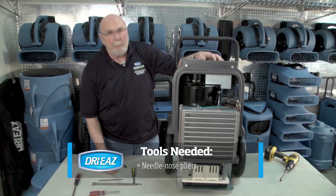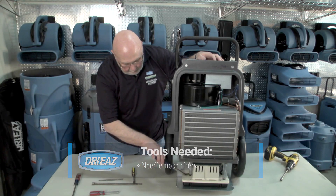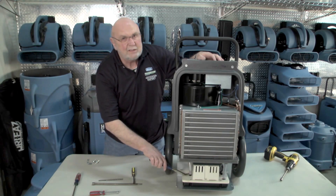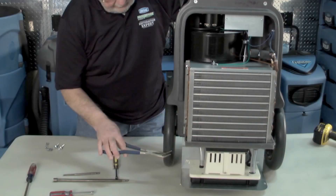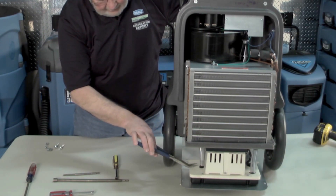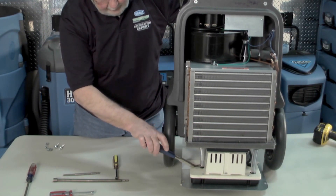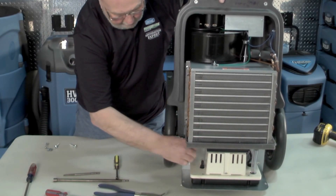The first thing I do in pump removal, if need be, is remove the braided hose on the outlet side. This is a check valve — it's plastic and it can break. It's best not to try to crimp the hose above it and pull. What I do is come underneath it with a pair of needle nose pliers, push up, and it usually will pop off.